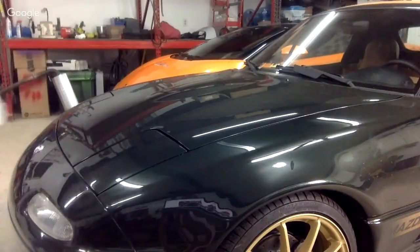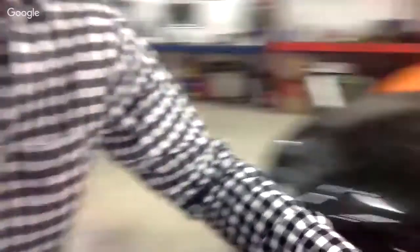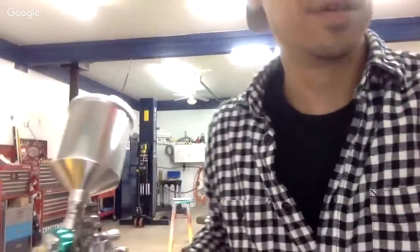I'm telling you, I've sprayed metallics for many many years and never had an issue with tiger stripes. That is the trick — if you spray like that you're not going to have any issues with metallics. Just up the pressure, back it up, cross your pattern, and you're not going to have an issue. Hopefully you liked that — it's really simple.